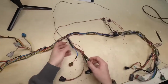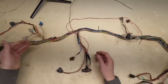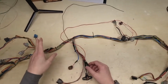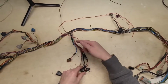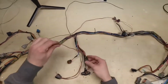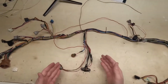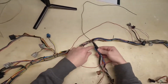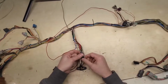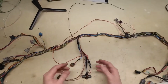One of them is sensor ground, one of them is sensor power. So I'm assuming we have one wire coming in, that is the source, and then we've got three going out the same direction and one coming out to the throttle. So this is a 1 to 4 breakout. We need to delete this wire without disturbing those other four because they're important. And the same goes for the junction down here, which is the sensor ground. So what I'm going to do now is take this apart and show you how to make it super clean. But there is an easier way to do it.